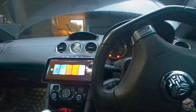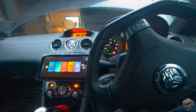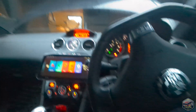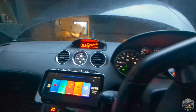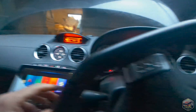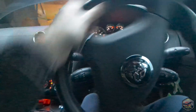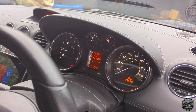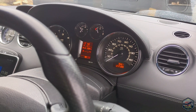Moment of truth — let's try and start her up. There's a bit of hesitation at start and it brought some faults on, but that's to be expected. I'm going to investigate those faults — it's probably because the voltage dropped when I started her up. It's still saying engine repair but we need to clear that and let it figure out the fault is not there anymore. I've plugged back in, cleared all the fault codes, started her up, and so far so good — nothing's come up. Great success!